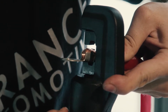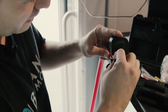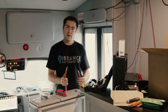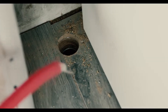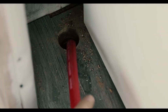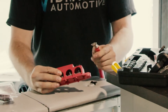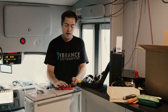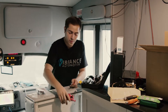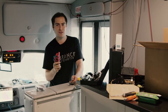We're going to go ahead and line this up and hope for the best. I can only make basic assumptions about this machine - no one came in and taught me how to use it. But it actually made a really, really beautiful crimp. What I can now do is run this bottom end down the hole I've drilled and bored out and run the rest of it to my power block. My power block here will take my input at the front terminal and from there, all the other receivers will transmit power to other devices. This will allow me to run that power without grounding out on the metal chassis.